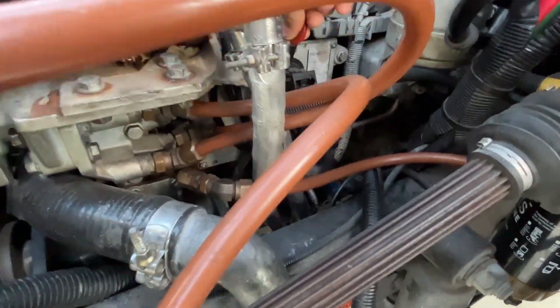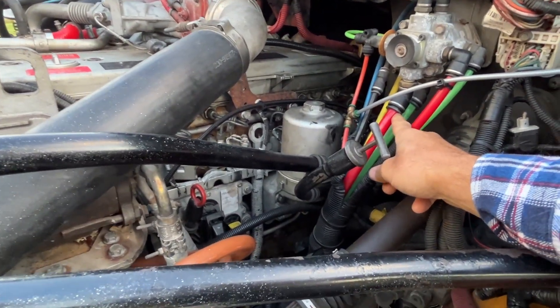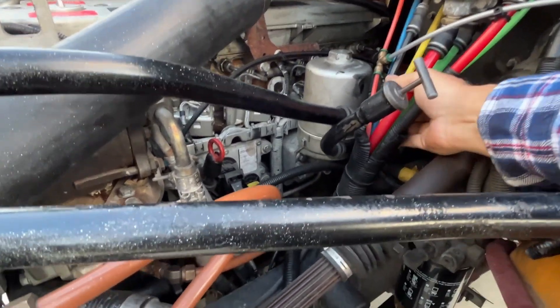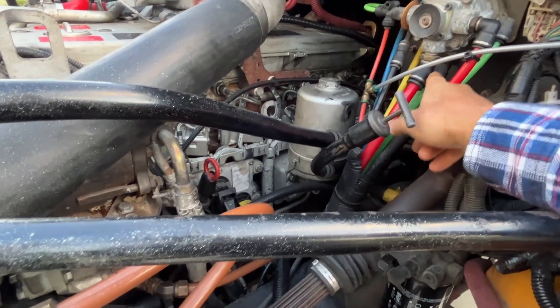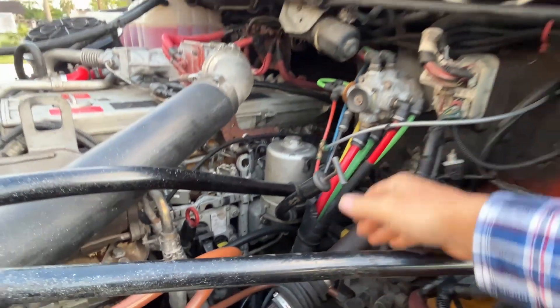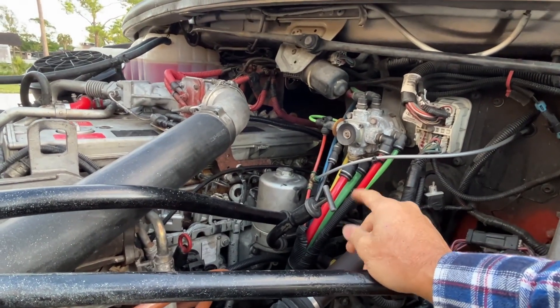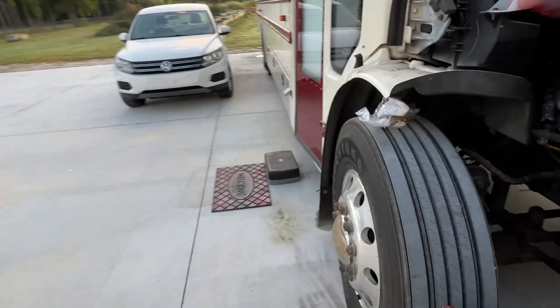So today what we're going to do, for starters anyway — I've got air leaks on these large fittings. I guess it's because they've been disturbed from pulling. Now I've replaced these already once; these are relatively new. I've never liked this push-on design, so I bought a bunch of brass compression fittings, old style. These things are bulletproof.